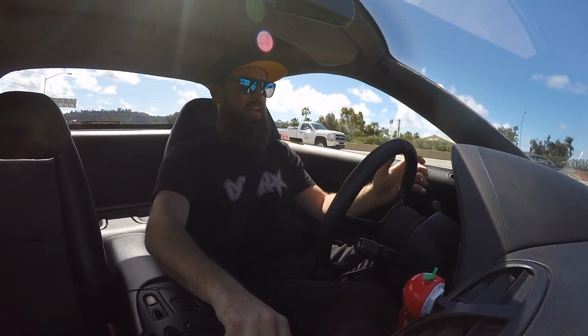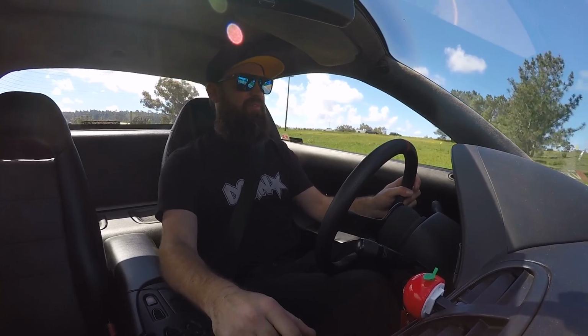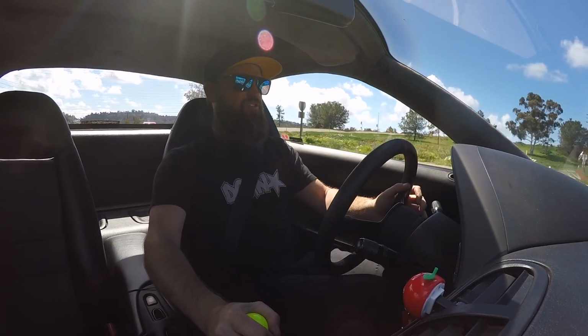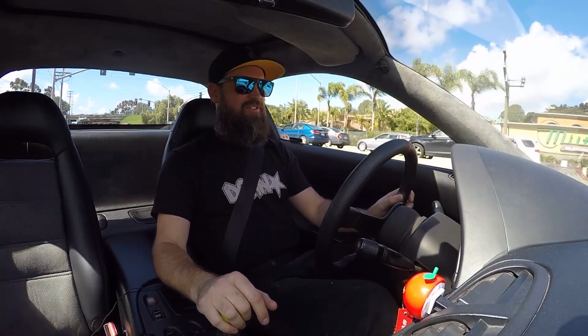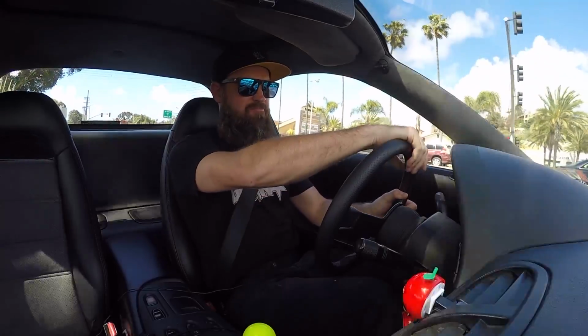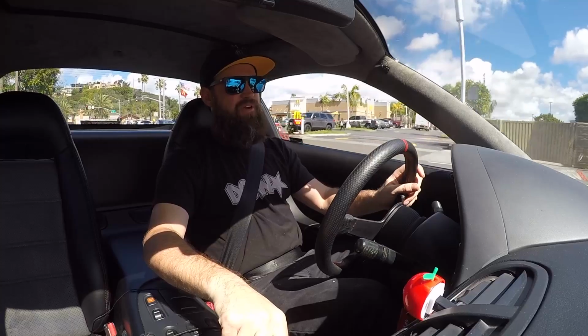So that'll be an exciting add to this car because it's going to make it perform a little differently. It's going to come on power a little sooner than it is currently, which is going to be hard to imagine because the Garrett turbo is constantly spooled. The 3584 Garrett Gen 2 is such a bad unit, and the internals are so good, that this thing's basically spooled pretty much non-stop, it seems. And it seems to be the perfect turbine size for the 13B for someone trying to make, you know, 350 to 550 horsepower. This car made 539 on the dyno the day we blew it up, and we detuned it down to 450. And I wouldn't have it any other way. 450 is heaps of power for this car. It's plenty and keeps it well within its operating range without worrying about blowing stuff up.